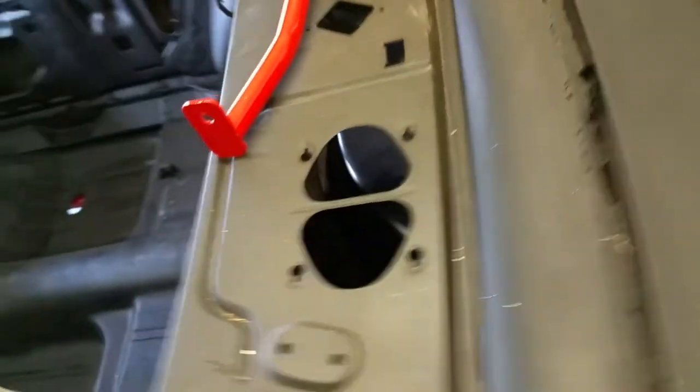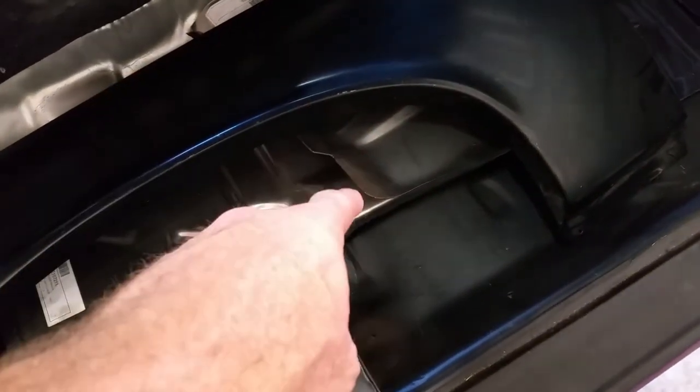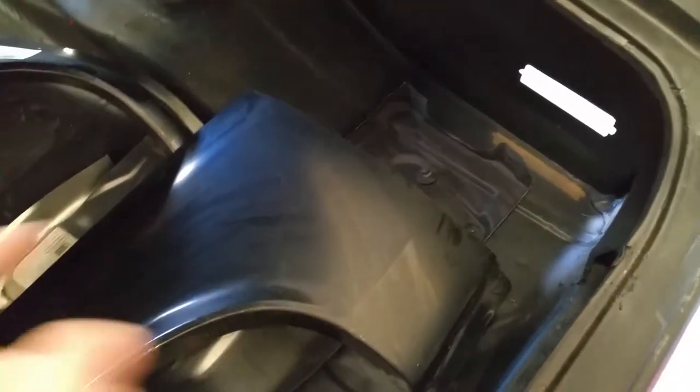Back inside. Let me show a little bit more of the Swiss cheese. I do have some replacement panels for all that, so that's no sweat. Everything is all taken out. Here in the trunk — here's my panels. Fender patch panel, quarter panel patch panel, outer wheel well, driver side floor pan, and that is the driver side toe board. I am going to mount the battery back here in the back — I can't stand an ugly battery sitting up front. Why not spend just a little bit more money and time, put it in the back and clean up your engine bay. This taillight panel is going to get replaced as well — I do got some ugliness going on there.